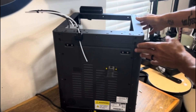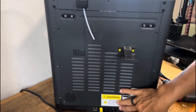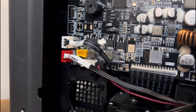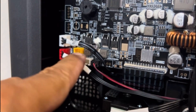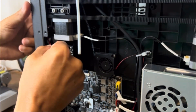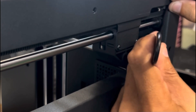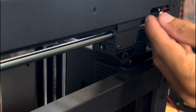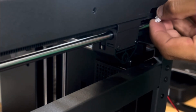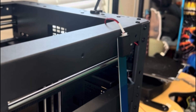Next, access the back of the printer and run your power harness. Remove the screws, unplug your main power for safety, and look for the yellow plug — that's where we'll gain power for the LEDs. Plug the harness in and look for a small opening to run the harness through. Using a flat panel tool, gently tuck the wire toward where the LED bar is mounted, ensuring the harness is clear from obstruction and won't come loose. Then route the remainder toward the LED light and plug it in.